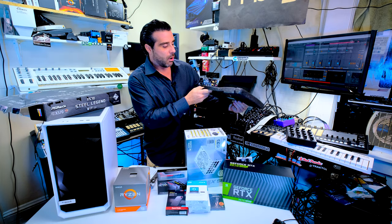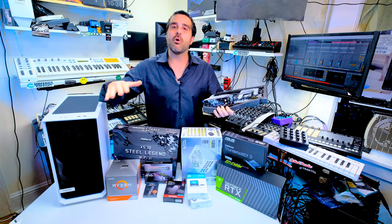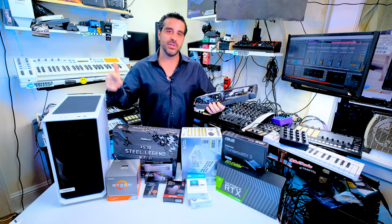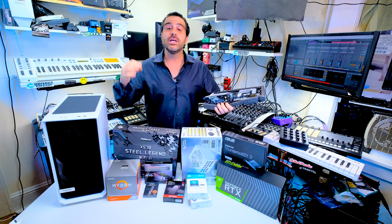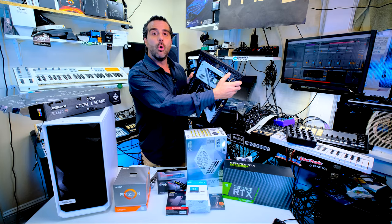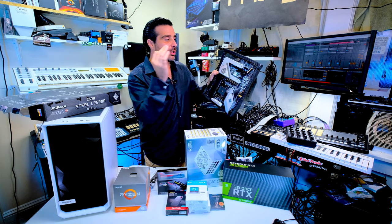Making this even more awesome, it has onboard graphics. So if your graphics card stops working or you want to multitask on two monitors, you have that. Right here is your TB1 header — Thunderbolt 3 on Windows. Yes, Intel certified. You're going to be able to run Thunderbolt 3. Do not buy an Apple computer — waste of money. You're getting it with this system. You're going to have to buy an add-in card to run it — I would recommend the Titan Ridge by Gigabyte.